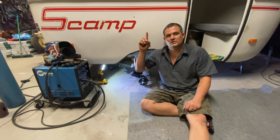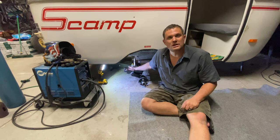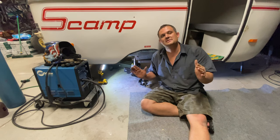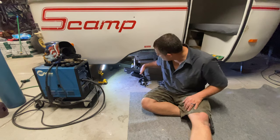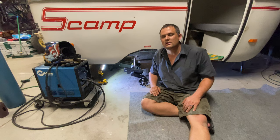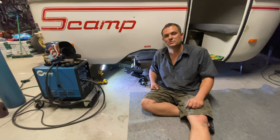Last time in part one, we made sure that we got the old axle out. We made some measurements and some marks on the frame and got the frame cleaned up. We have our new axle cleaned up underneath here on our floor jack. So what we're going to do is lift it up in place, get it centered between those two marks. The pad for the axle is actually about an inch longer on the new one than the old one, so we'll have to center that up in our opening. We'll make sure that the centerline of the axle still matches the centerline mark we made, and make sure that the axle is square to the frame on both sides so it's square to the entire chassis as it goes down the road. Let's go ahead and lift that up into place.